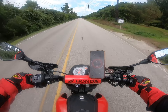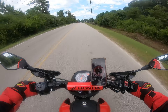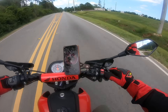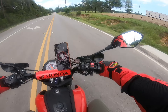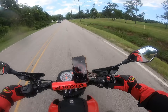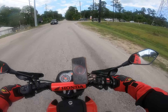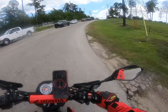You can see it's stopping around 46 and once I hit this spot it's going to go downhill. I'm gonna have to mess with my throttle cable — that's another reason I made this video. I had to swap out this throttle piece; normally it's plastic and it broke on me. I think one time when I dropped the bike it cracked, and I've been driving it like that ever since. Finally giving it too much throttle, it actually broke all the way on me. Luckily I was in the neighborhood so no issues there. I swapped out to this metal one and I can't get it dialed in right.